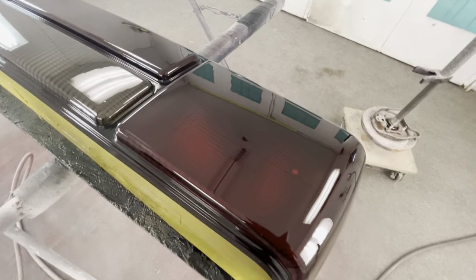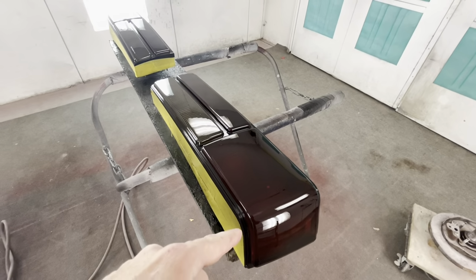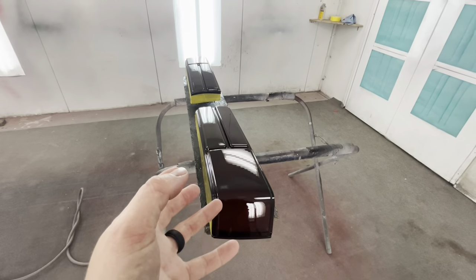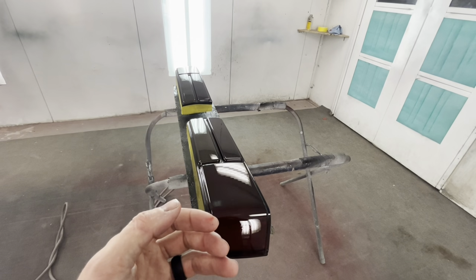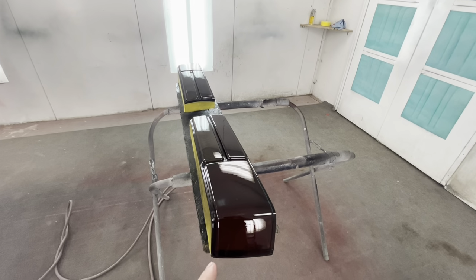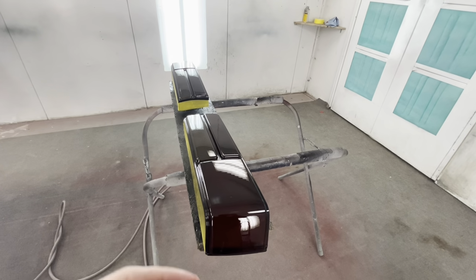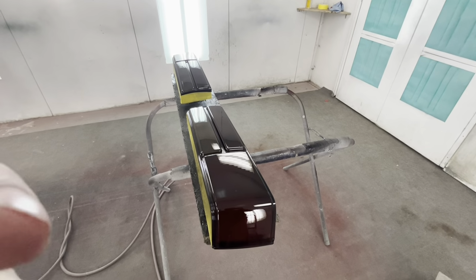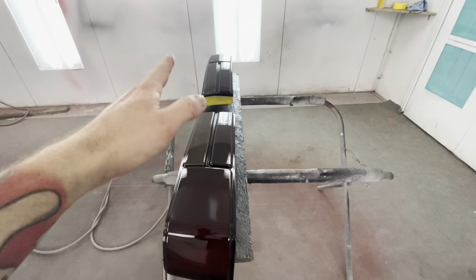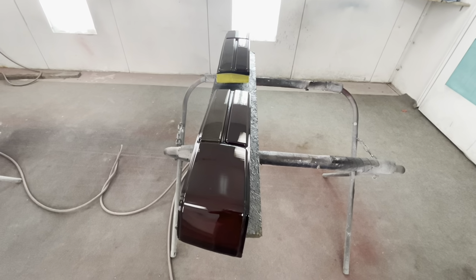So what this actually is, is a contaminant not on the plastic, because I know we cleaned them good, it's probably in the plastic. So when they pop these plastics, they put a release agent over the whole plastic, and that's what releases it out of the mold. And sometimes when you're painting plastics, it's really hard to get that release agent out. Now you use a product called Plastic Prep, which is basically rubbing alcohol. If you don't have Plastic Prep that we wiped these down with before we started filming, then you can use rubbing alcohol to wipe it down.